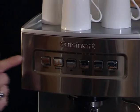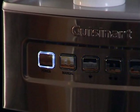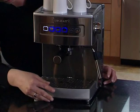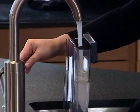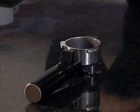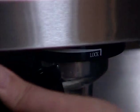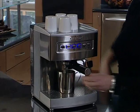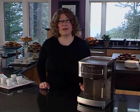Plug it in and rinse it by pressing the power button once to turn it on. See how the light around the button illuminates? You will notice that the manual one and two cup buttons will flash while your machine is heating up. Now, place the drip tray and grate onto the machine. Fill the water reservoir with cold, fresh water by holding it by the integrated handle and removing it from the base. Place it back on the base. Take the portafilter holder by the handle and drop any one of the filter baskets into it. Secure the portafilter handle to the brew head by lining up the handle with the arrow. Push up and turn it to the right to lock it into place. Place a container under both pouring spouts. Press the manual button and the water will run through. Do this for five to ten seconds. Now you're ready to make your coffee.